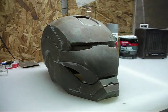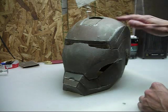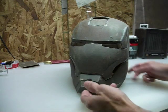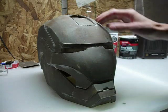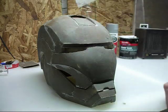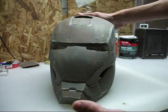Welcome into the next video in the series. Where the helmet stands at this point, this is actually the third and hopefully final coat of Bondo. It's a very thin coat. If you remember back to the first Bondo video, what we basically did on that first coat was we filled in the low spots. When we sanded down, we used our high spots in the paper — our joint lines — to tell us when to stop sanding. Once we hit those paper lines, we stopped sanding. That was the last bit of Bondo work you've seen.